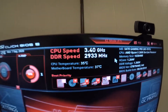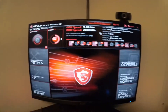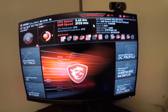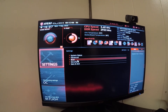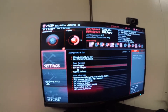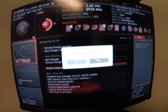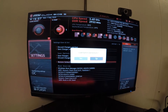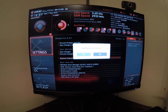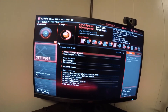After the update, you'll notice your DRAM speed may have been optimized — for example, mine went from 2133 to 2933. Also, go to Settings in the BIOS, then Save and Exit, and click Restore to Default. Click Yes — everything will clear out. Then turn off the computer completely, remove the old sticks, and put the new ones in. Go back to BIOS, click XMP, then turn off the computer, turn it back on, and your computer should do the rest by itself.